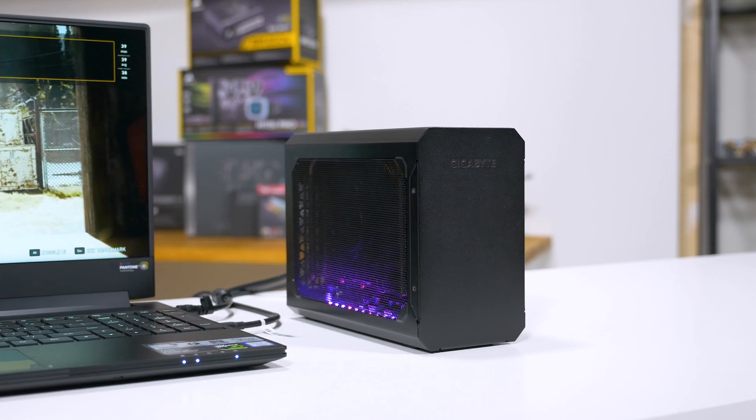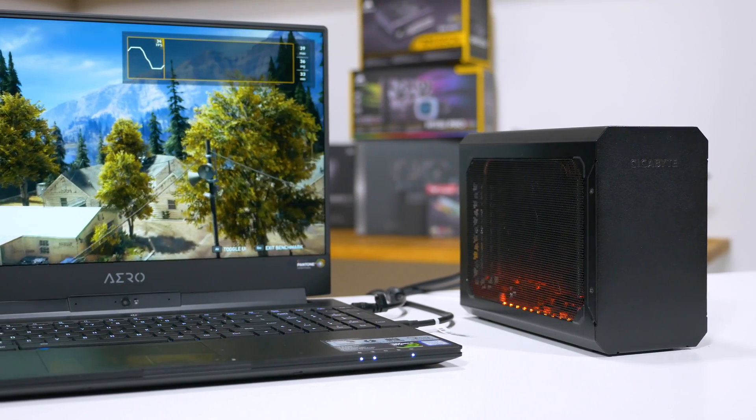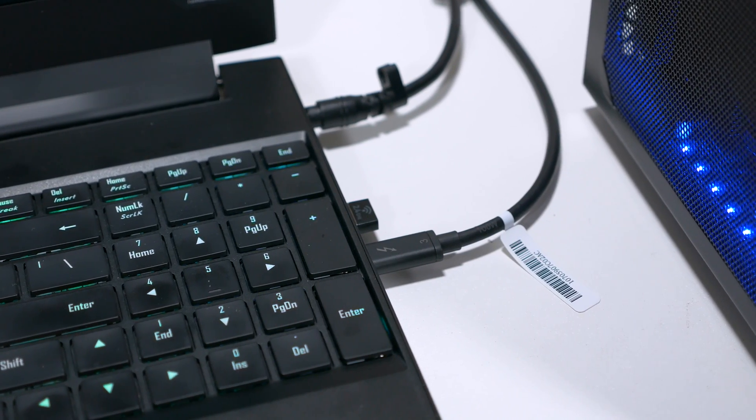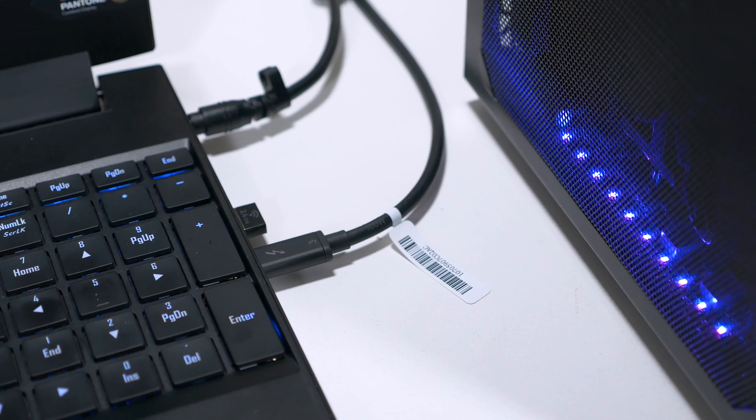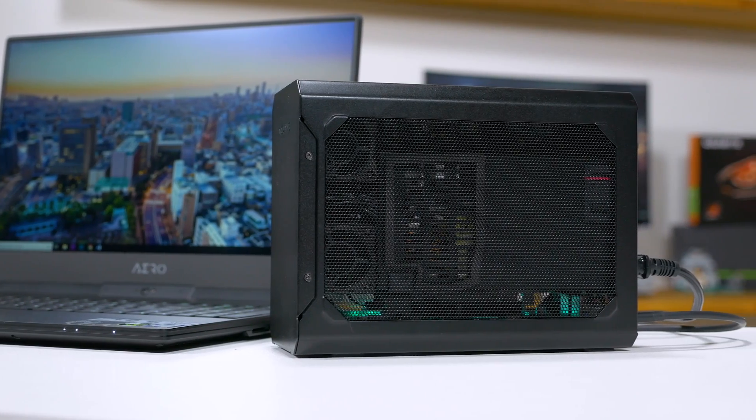For this review I'll discuss how the RX 580 Gaming Box performs in a handful of games at both 1080p and 1440p. I'm not focusing on comparisons to other Gaming Boxes since we already know how the RX 580 stacks up against the GTX 1070 and GTX 1060. There are limitations to external GPUs that prevent desktop-class performance through Thunderbolt 3 — bandwidth and latency are the primary concerns. Thunderbolt 3 latency introduces a performance penalty to any graphics card on any system, so no matter how fast your CPU or GPU is, an eGPU setup will never reach proper desktop-level performance. Interestingly, this latency penalty levels the playing field among mobile CPUs — the difference between a 15W U-series laptop and a 45W H-series laptop is only a couple of percent.